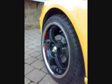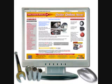As with all brake discs and pads, you should allow 200 miles of bedding in time, during which time heavy braking should be avoided. To have these brakes fitted to a franchise dealership would have cost about £130, and that's for labour only. You can buy the product yourself and save. Even if you take them to an ordinary garage, a non-franchise dealership, they will charge you about £45 to £50. The whole procedure of fitting the brakes to this vehicle took 45 minutes, and on most cars it's less than an hour.